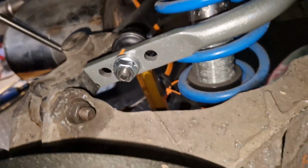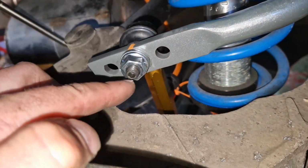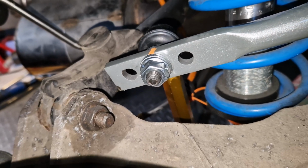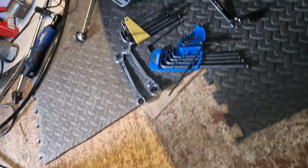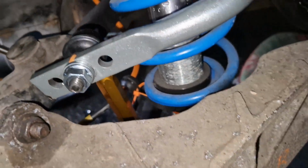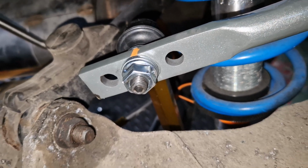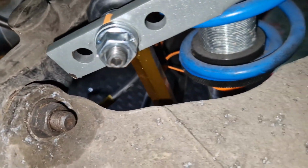I did get really confused for ages just now. This was the last one I did, and for some reason the Allen key, what did I say it was, 4mm, 5mm, it wouldn't fit inside it. I thought I was just being a right donut because I was lying on the floor trying to do it above me. It turns out I actually needed, I've got an Imperial set of Allen keys, and one of them fits snugly. I don't know, do they do these for America? I think they use Imperial, don't they? Whether they've got a load of these that they send out to America, and one of them happened to end up on this particular drop link. So yeah, watch out, you might need some Imperial Allen keys.